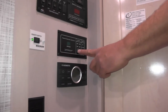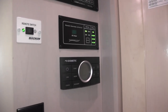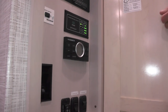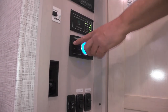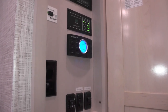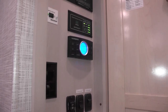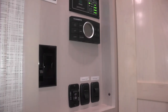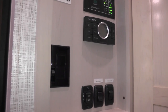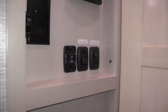The power management system watches over the coach — it will tell you what you're using. Currently on 50-amp service, it monitors the water heater and all three ACs, trying to keep you from tripping breakers by turning functions off and back on as needed. The thermostat controls all three zones: Zone 1 is the kitchen-living area, Zone 2 is the bedroom, and Zone 3 is the garage. In toy haulers, a heat pump is always put in the garage since there is no ducted heat out there.